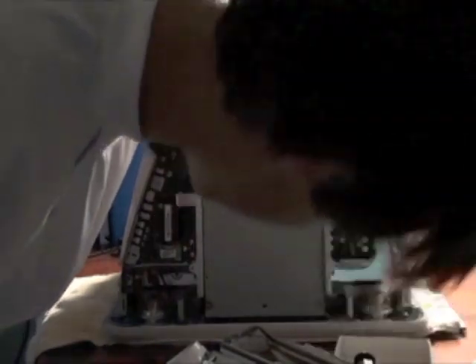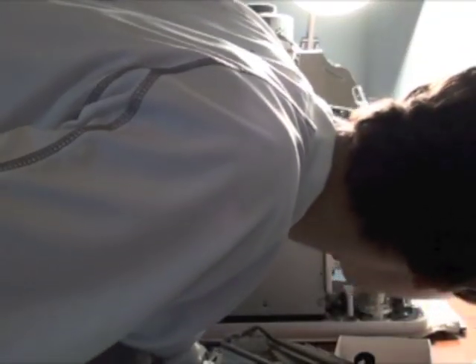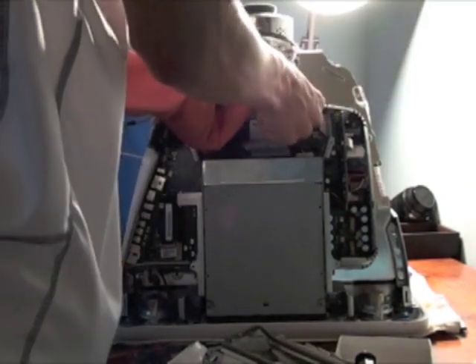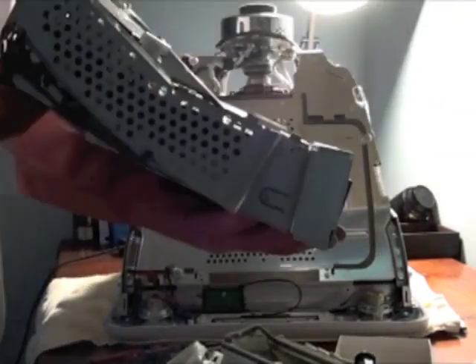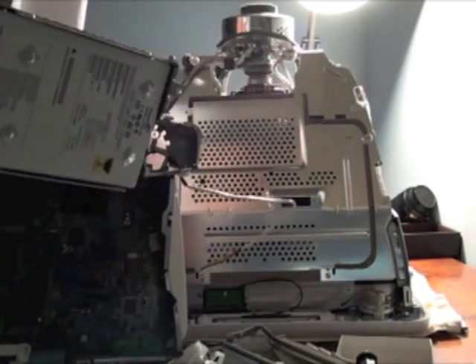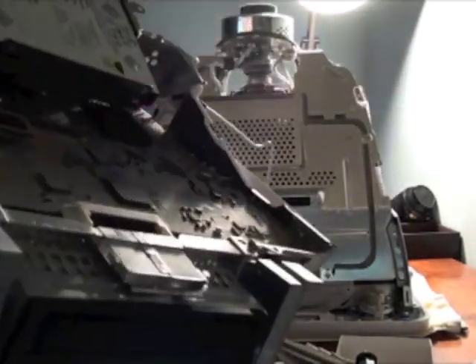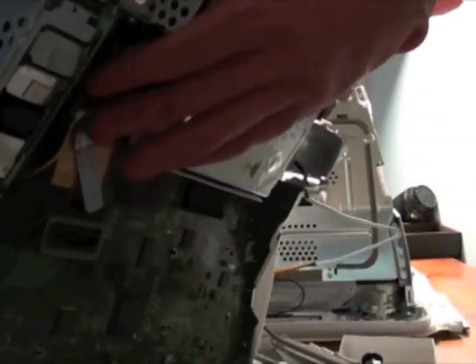Make sure it's loose. Make sure you have no wires connected because this is the moment of truth. Now you pretty much just pick up from here in the middle and pull it off. And there you go — you actually have your whole eMac motherboard. There's your hard drive — it's pretty easy to change that out, you can figure that out yourself. There's your super drive, and there's your processor underneath that golden heat sink right there.